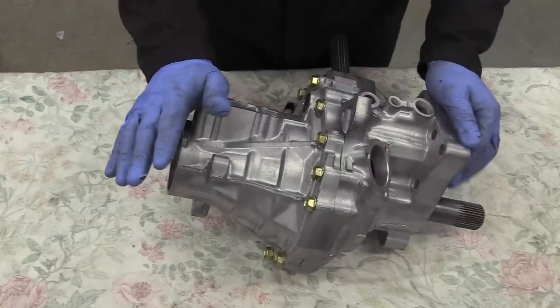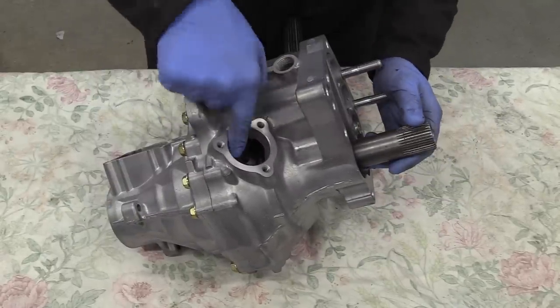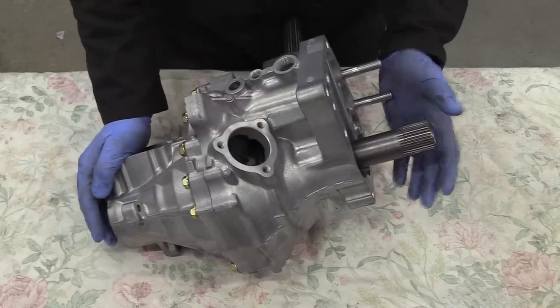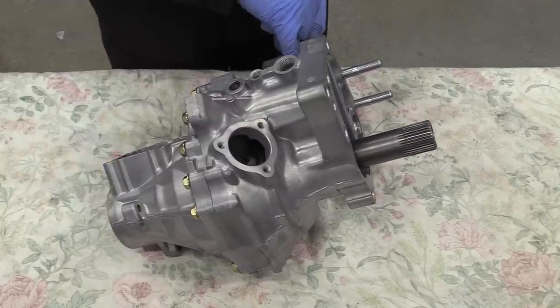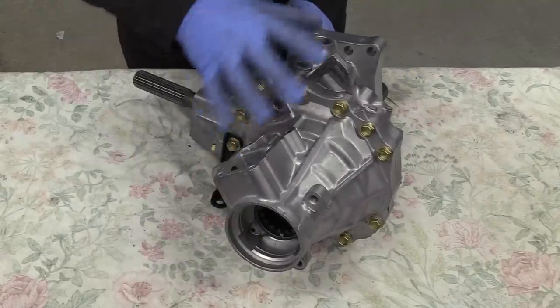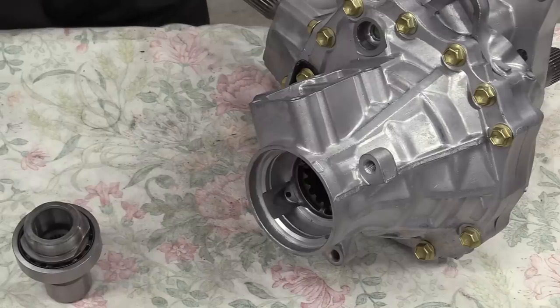If you were rebuilding this transmission, especially the transfer box, you'd measure the backlash through this little hole here. We haven't changed anything, so it should all have gone back together as it was. Certainly feels about right, but it's those shims there on the back housing and that little adjuster knob there that adjust it all. So that means we can install the front diff right hand drive shaft carrier bearing thingamy.